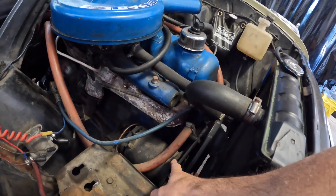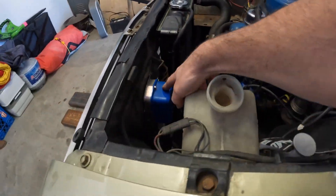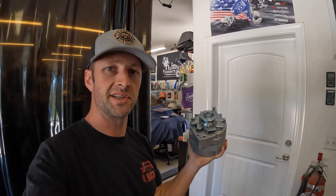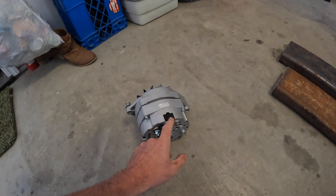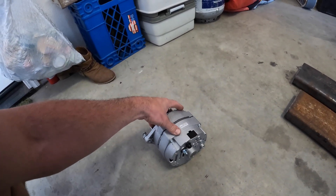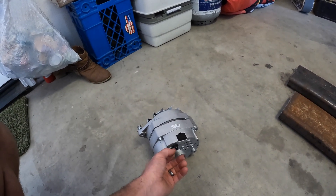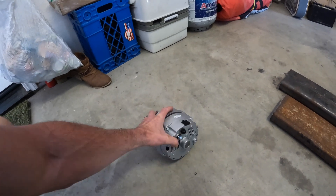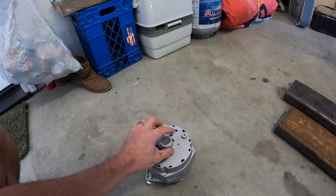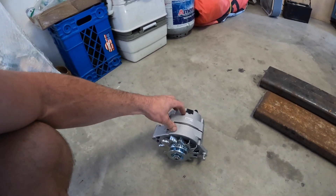The first step is getting the old generator and voltage regulator out of the car. Here we have the old belt-driven generator — it only has a few wires on it. They run across the radiator support over to the voltage regulator. I picked up this 10SI; it's a very common Chevy Alternator from back in the day. This one's actually been retrofitted as a true one-wire — the regulator connection you normally find on a 10SI is gone, and it has a different aftermarket regulator inside. I got this from a friend who does starter and alternator work in my town, he tested it, and I saw it pull 80 amps. All we have to do is mount it, spin it with a belt, and attach this battery lug to either the battery or the starter solenoid, and we're good to go. It's a pretty simple system, pretty common — if it ever dies, it's readily available at a parts store.